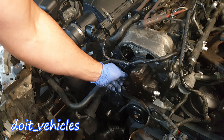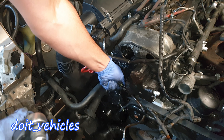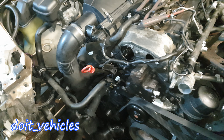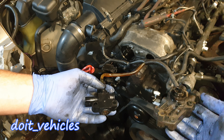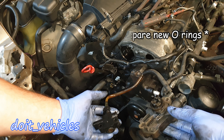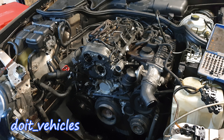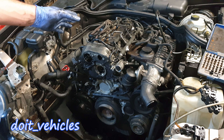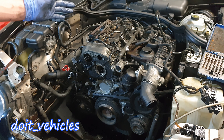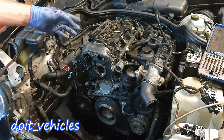With the E10 there is a bracket on the high pressure fuel pump — I've got a separate video about these parts. This is the return line which can be placed separately. Disconnecting all these fuel lines can be quite difficult, but that's how you can avoid disconnecting all of them. From this point, remove the valve cover gasket as well — this can be a long process so I'll skip through to where the valve cover is off.